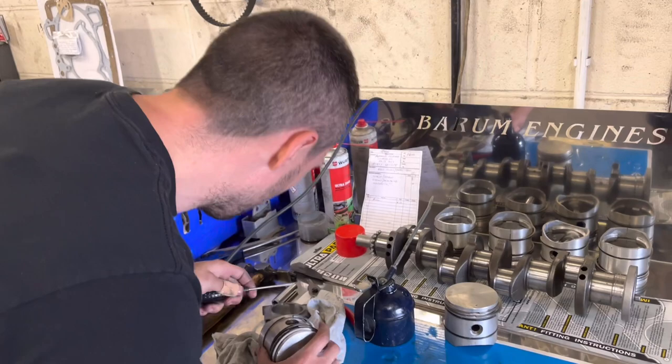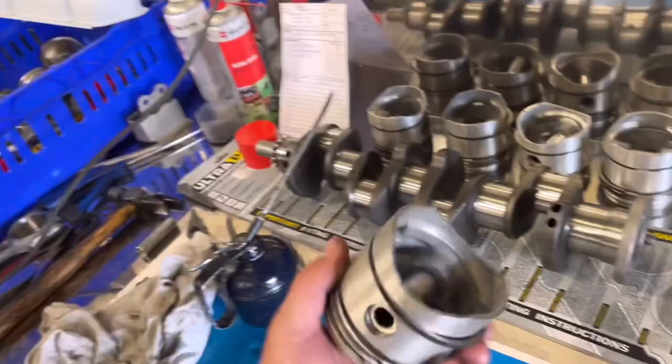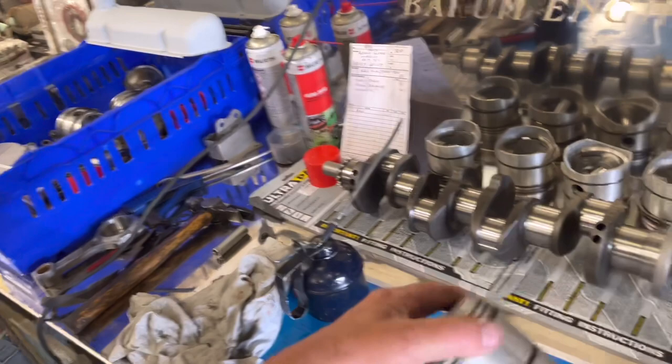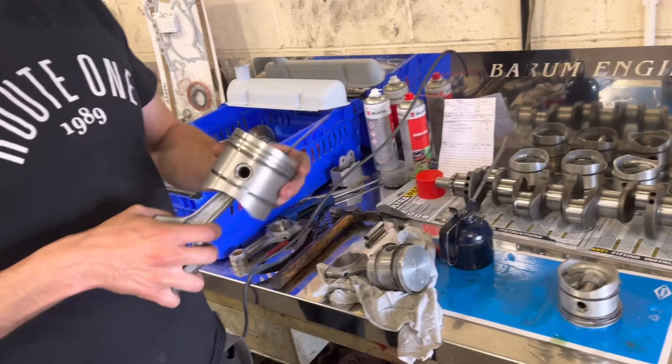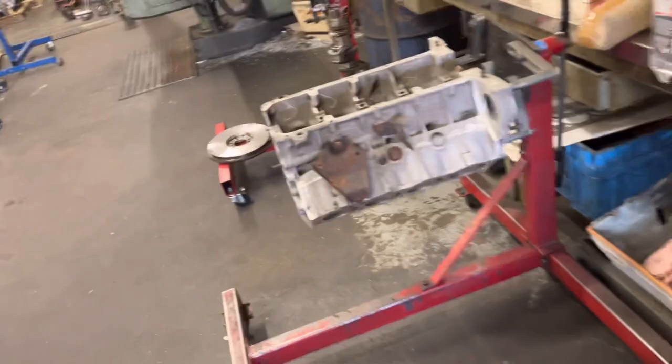They're meant to be tight, obviously. Yeah, they usually are pretty tight. The gudgeon pin is quite tight in the rod and quite tight in the piston — so a bit of wet and dry. Tighter the better, mate. They're made fiddly but there's no play there. Very nice, well done.